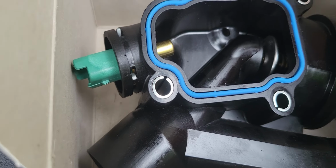Now we're going to change the thermostat housing assembly unit. And this is the coolant temperature sensor that will trigger here. And this is some kind of assembly for the cooling fan. Once the thermostat temperature sensor sends a signal that the coolant is hot, this fan will activate on the system, and then it will cool down the temperature of the coolant. And since it's a kind of big engine operation, we're going to start stripping the thing now. Okay, so let's wait.